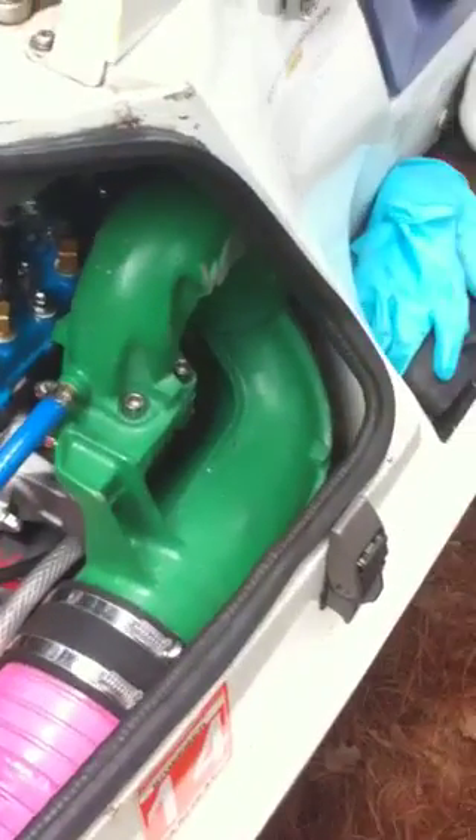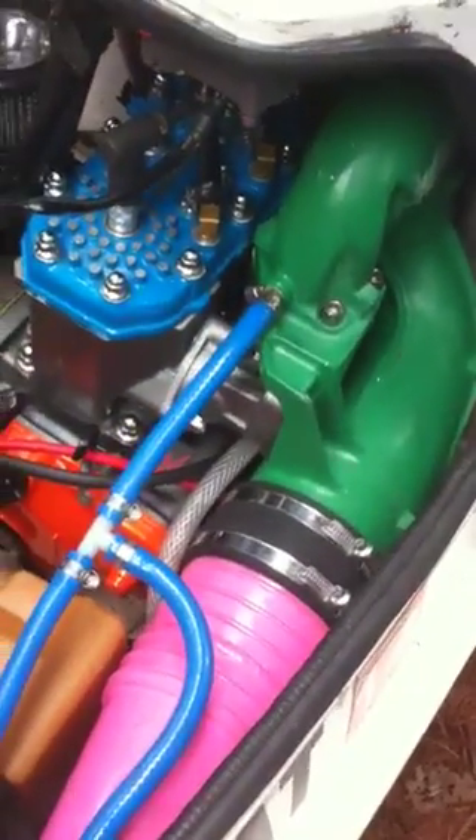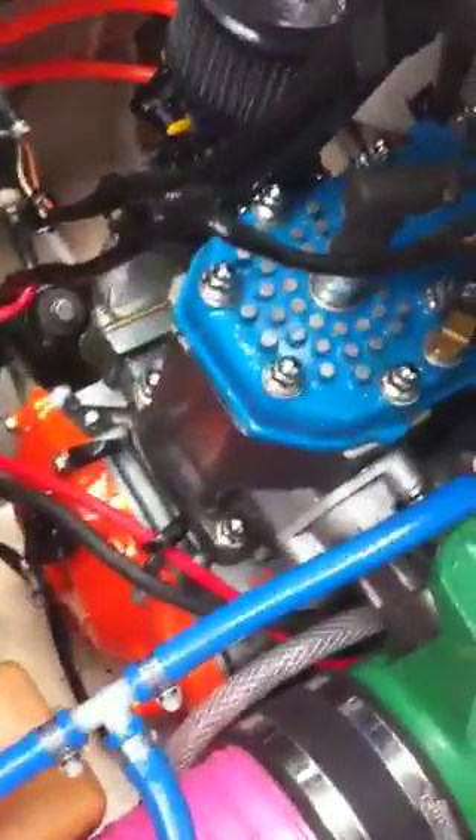You can see I've got a west coast exhaust pipe in here that he's painted green and pink. I've put brand new fuel lines on — these are real cool looking fluorescent orange. I no longer have the same head; I've got a west coast high compression head for about 170 psi compression. There's the SBN 44 carburetor and air intake, and all I've got to do is put a battery in and some gas in and she'll be good to go.